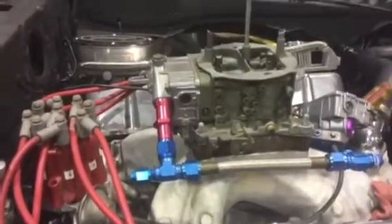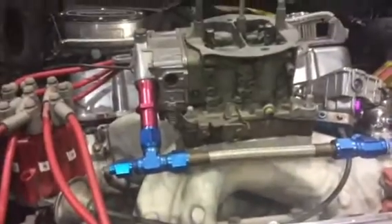This one has water in it. The fuel — what the mechanic said — looks fine from the tank, but it was clogged in the line. Hence, when you went to give it enough gas, it got more air than gas and fell on its face, because it was clogged.